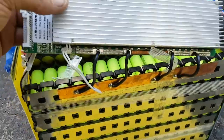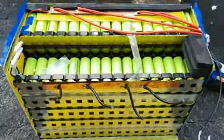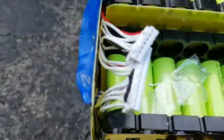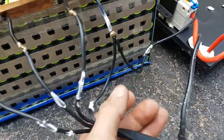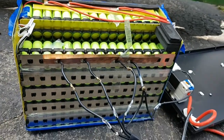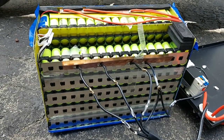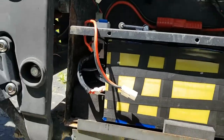I'm gonna cut these black ground wires off and connect those blacks to those blacks from the other side of the BMS — just to test; I'm not gonna leave it like that. Put it all back in my bike and see if it runs. If it runs, I know it's this shoddy piece of junk right here and I have to replace it. At least Tao Motors has Samsung 25R 18650 cells — at least they've got that going for them. Now that the BMS is out I've soldered all the leads including the charge lead, though I'm taping that up since I won't be charging for this test. Close the box back up and put it back in the bike.